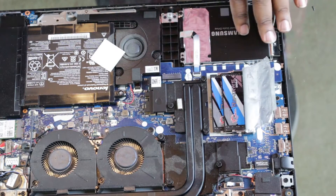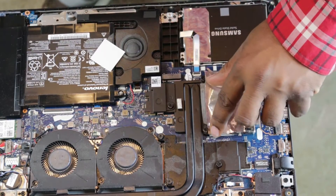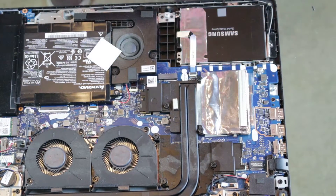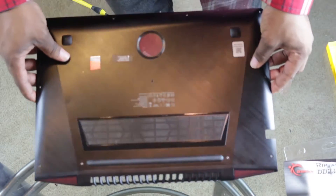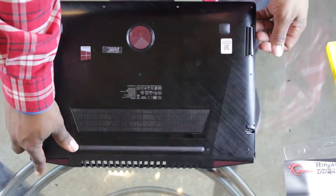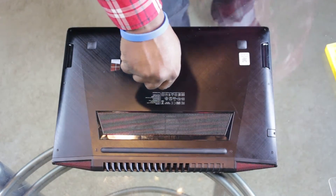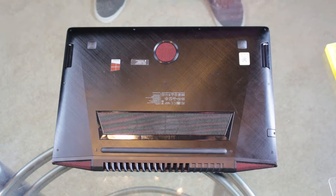The hard part is actually opening it more so than putting the RAM in. Make sure you check out the video if you want to change your factory hard drive to an SSD. Put the cover back over — it kind of fits under those screws, you don't even have to unscrew them, just seat it under. Then get ready to replace your cover and your screws and you're basically done. The back part wraps over the back end of the laptop; set the frame in over the speakers. I recommend putting all your screws in first, seating them in their holes, then screwing them in individually after — it's just easier that way.